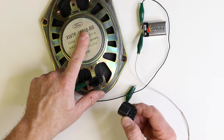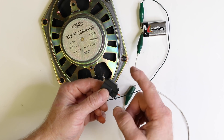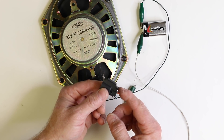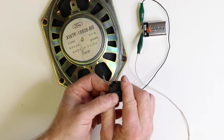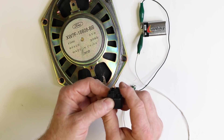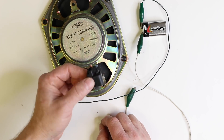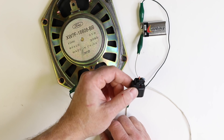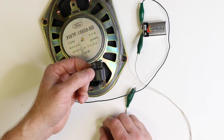Because the speakers are universal, they're not going to switch them from door to door. So on any other speaker in the car, as long as it has this plug, this wire will always be positive. What we like to do is make sure the positive wire is standing nice and erect, and we bend or limp out the negative. As we move around the car, we take this connector with us, go to each door, hook it up, and make sure they're all positive.